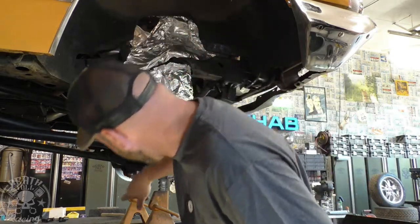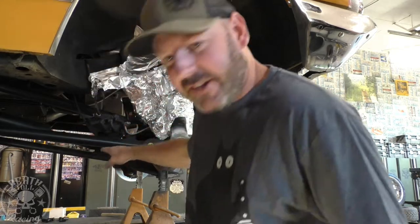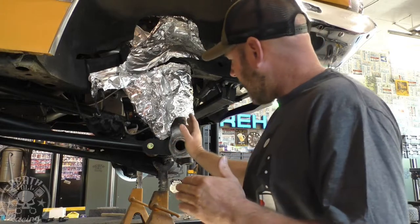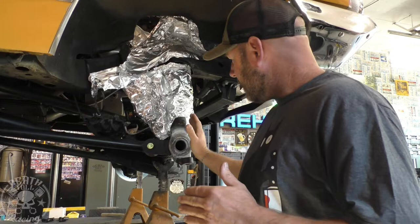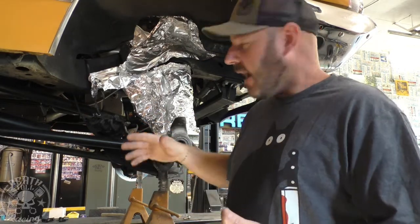And it's kind of hard to see with my brake caliper there, but I have my drive line pretty much going straight in. So the pinion and the drive line are going perfectly straight, and I know that I'm never going to go like this. So that's why I want to keep this at 6. Because as I increase this back with my four link arms, it's going to increase my caster, so that'll go up, but it will then make my pinion angle go down this way, which is okay. It's better to go this way. You don't really ever want to go that way.